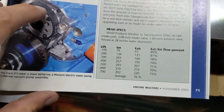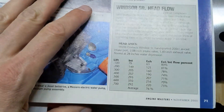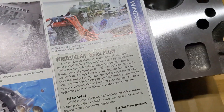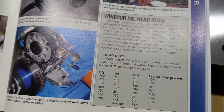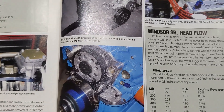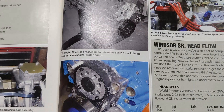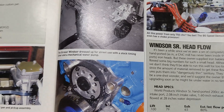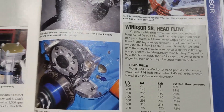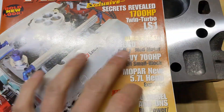As far as exhaust goes, I did not have these heads re-flowed on the exhaust side - there was additional cost at the machine shop and I didn't do any exhaust improvements other than polishing the chambers and narrowing the exhaust guide some. I'm pretty sure I could improve the exhaust numbers by making the ports wider and taller, but I kind of want to get this engine together, so I think the exhaust numbers are good enough.